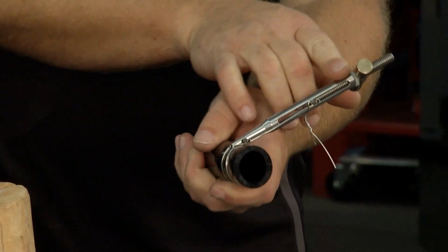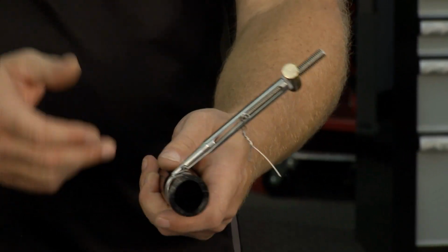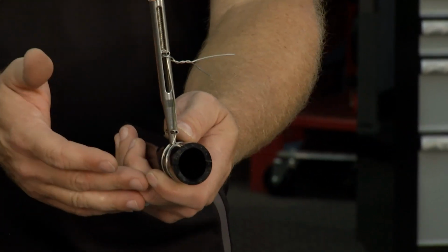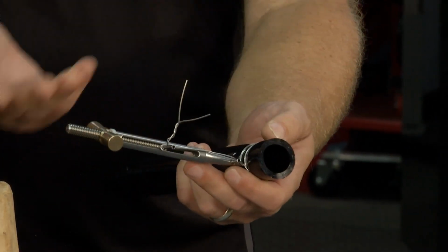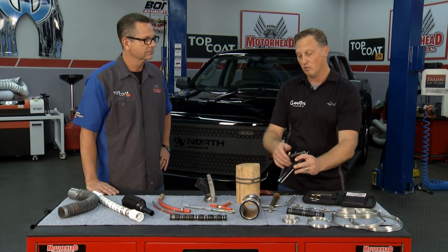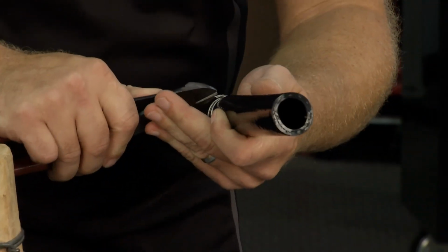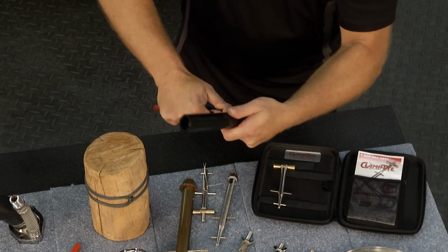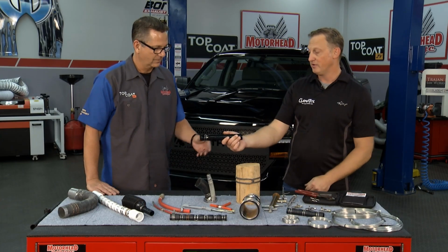So when you're tight, we got plenty of room here. We're going to flip it 180 degrees. If you're up a radiator hose, something like that, you got all kinds of room. Lower down into that engine, you're only getting about 90 degrees, so you just snip off here, bend your tabs over, and you're done. I've got the room, so all the way over, tool pops off. About 1/4 inch is all you need. And once that's down, I don't care how much pressure you're pulling under the hood, that's not going to vibrate loose, that's not going to come off.